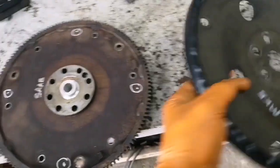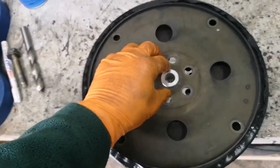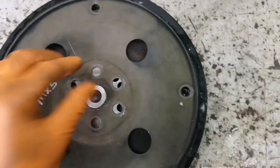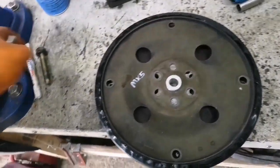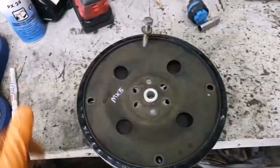That is super snug on that. Marked out roughly where I'm going to have the holes. Then I'm going to take the whole thing to the pillar drill, drop the 12mm drill bit through. Then I'll probably chuck a bolt in just to hold it in place to get the rest.